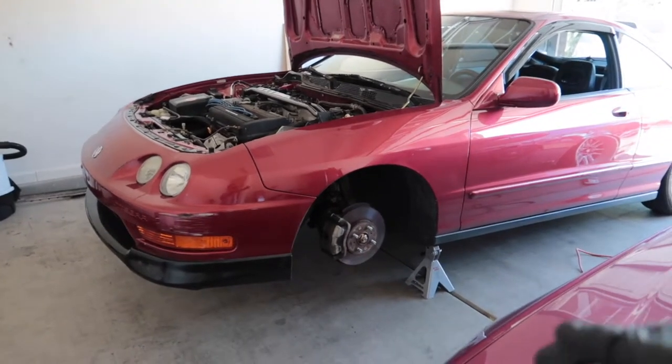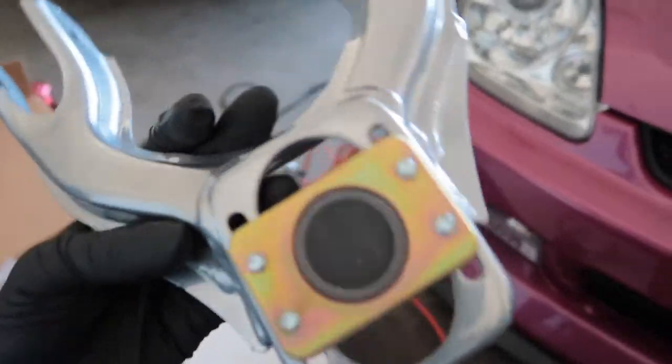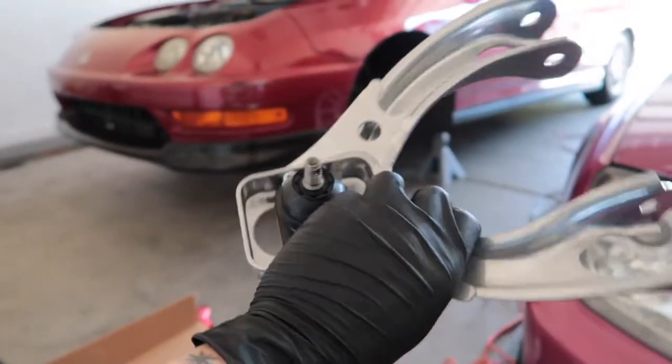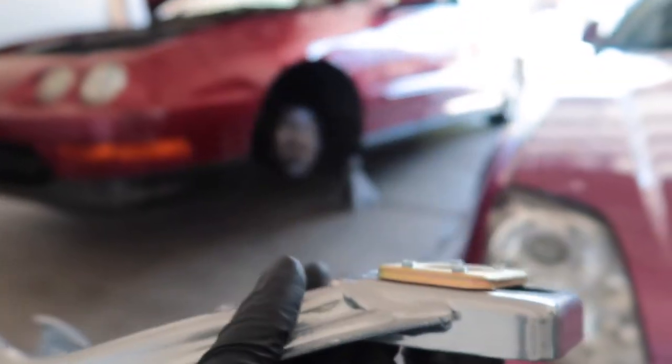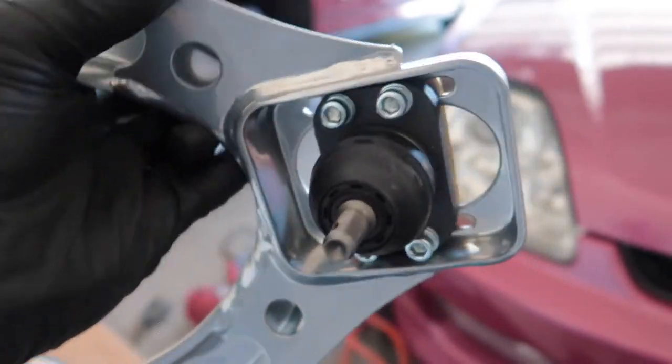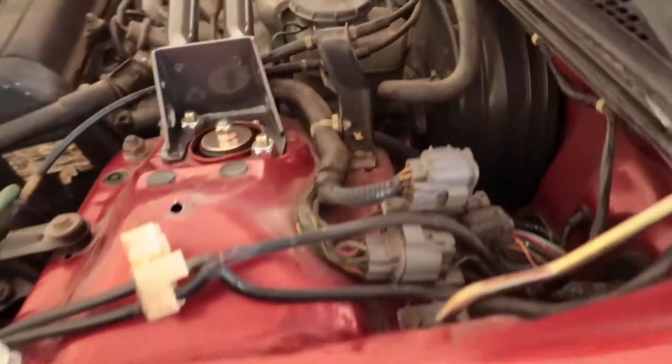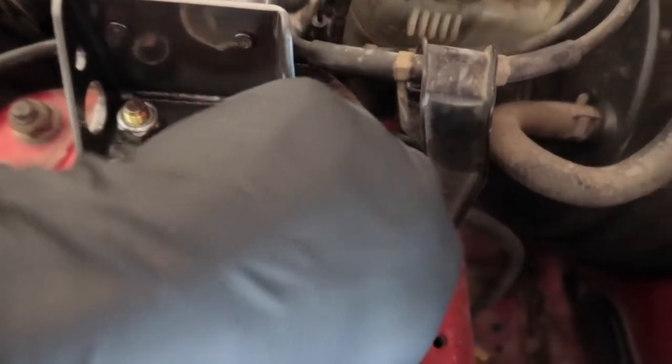Now knocking out the front. Here are the front camber arms — this one is for the driver's side. I don't want to go too much camber up front right now because I'm rubbing a lot and I don't want to raise the car. Here's the sliding plate — I locked these as tight as I could without stripping them and put some Loctite on them. To install: take out the cotter pin, loosen this bolt, use the ball joint splitter, and there are two bolts on the strut tower — undo those and it should drop right out.